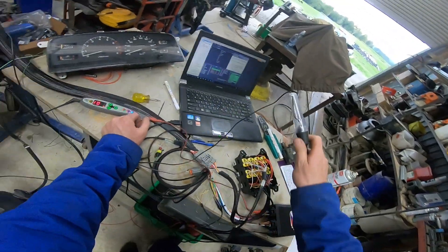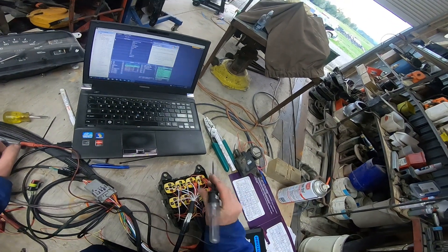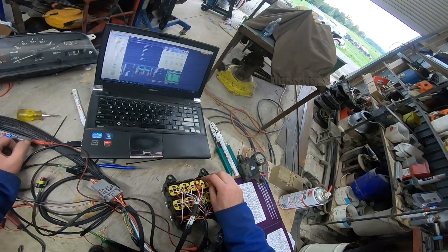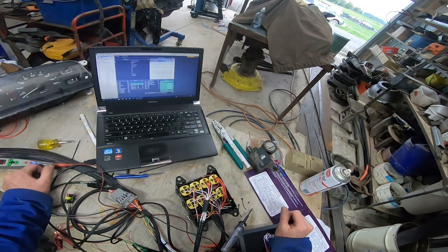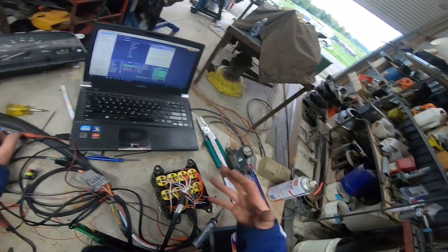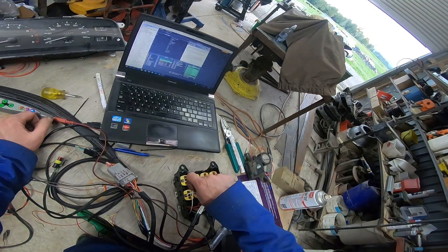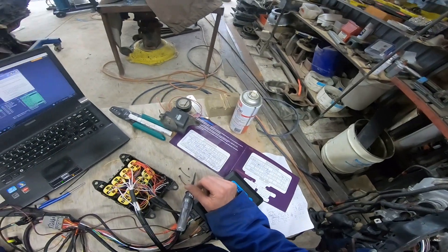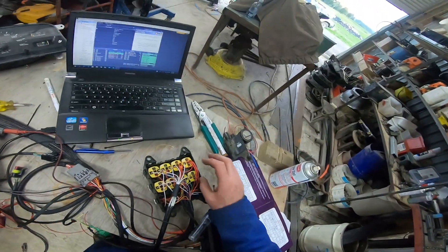When I was actually testing this one, I had the EFI relay on and configured the ECU. As I slowly put the relays in it had a bit of a backfeed — when I put the fan relay in it made a quick change. What I'd done is I'd fed straight ignition to the fan circuits. Normally it's okay, but this one it backfed through that fan circuit. It wasn't much to change but I'll talk about that in a moment.